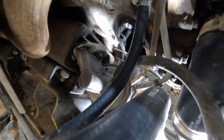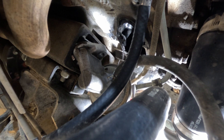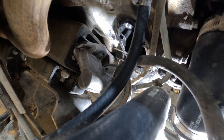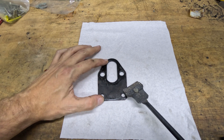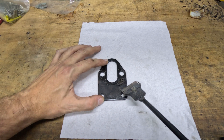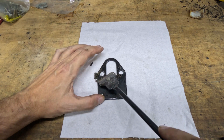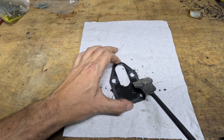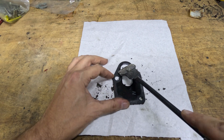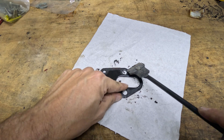It's easier to scrape the old gasket off from underneath. My trusty NAPA razor blade scraper on a stick - I've had it since high school - is what I'm going to use on the block-off plate. I can tell I'm on the right track by how much oil residue and buildup there is. The inside has another baked-on gasket, so that's going to be a bit of a chore getting it down to bare metal.